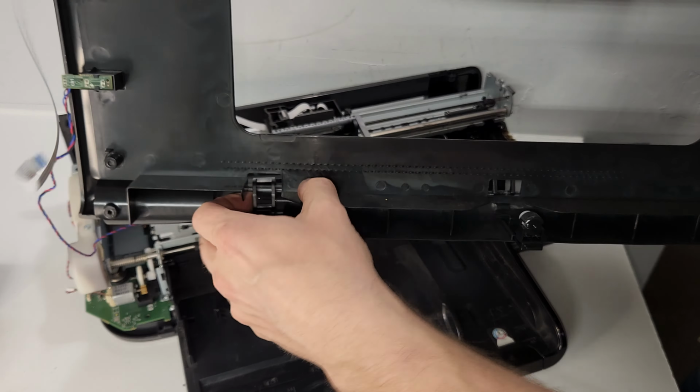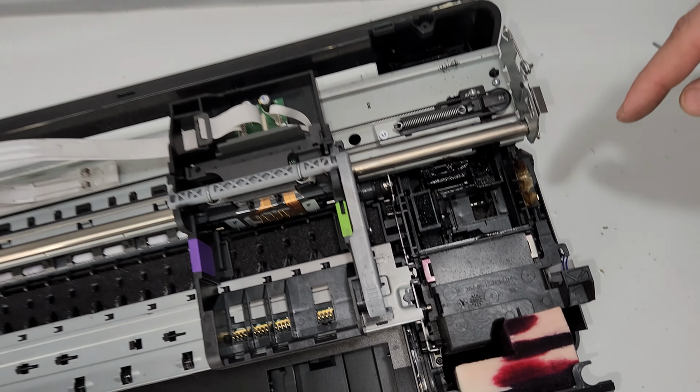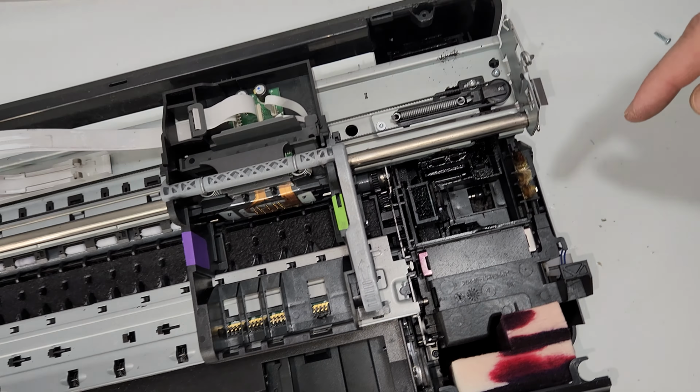So that's what the printer looks like inside. If you need to clean the timing strip, you can do that just while it's here. Very simple to do that. So you can see there was some use on this printer. So we'll just continue going through. But if I was to use this printer, I would clean this gunk right here. You can see there's plenty of it in there. Just to kind of keep it going, I would clean the timing strip in order to avoid any paper jams or just extra lines on the printer, or it may just cause errors.